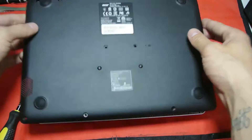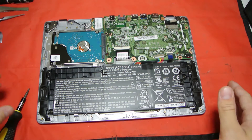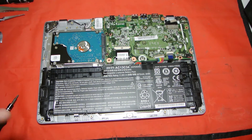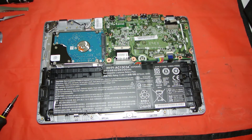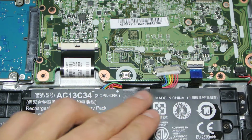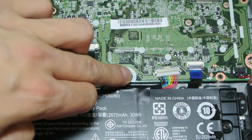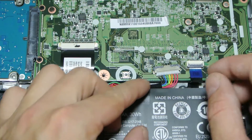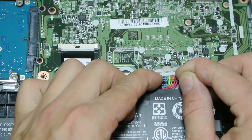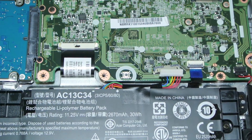Once you've worked around the back, the panel just lifts up. Before you do any upgrades, note that it has an internal battery and you are going to want to remove it. Here you can see the battery and the port it's plugged into. What you need to do is give it a long press — about five seconds — and this just turns the battery off. Do that before you do any upgrade.